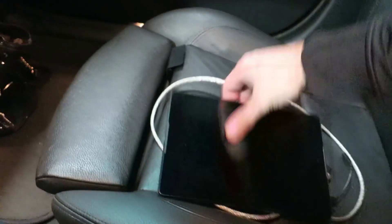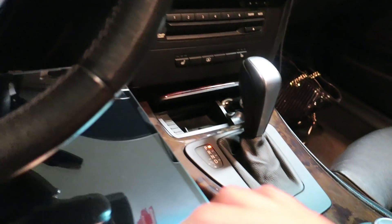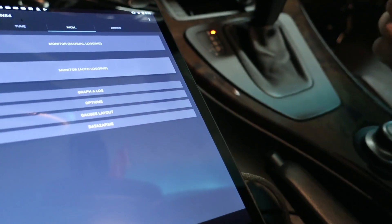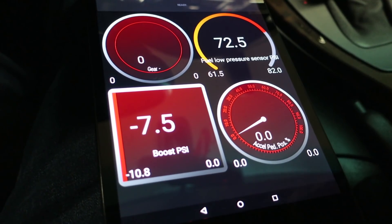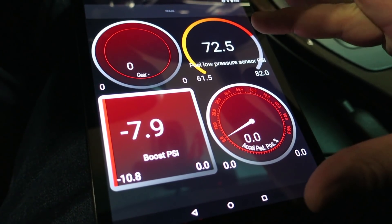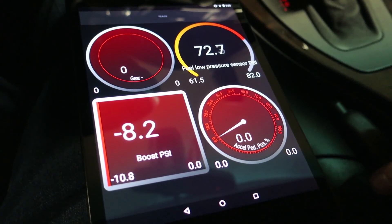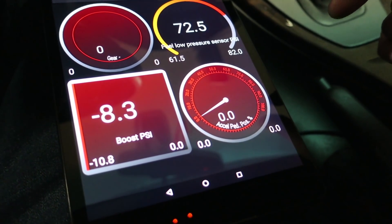The way I plan to data log is via MHD using a K+ DCAN USB interface cable. The car hasn't gone to sleep yet, so as soon as I plug in the cable it should go right to MHD. We want to use auto logging. I'm set up with the tablet connected to the car. With the car running, we're going to do a pull in third gear from about 3,500 RPM to redline. It's going to save a data log file on the tablet, which I'll export to my computer and use a piece of software called virtual dyno to get a pretty good representation of what the car is making in terms of power.